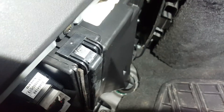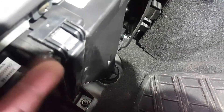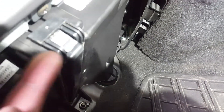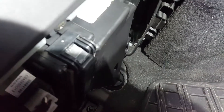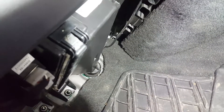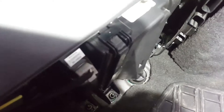You can see it up in there — the slot there, clip at the front. Push it right the way back up in there, and right at the back you'll see that's where the retaining bar is going to clip into. You can see that retaining bar tucked in there nicely. Don't try and get that bit up inside here — it doesn't go there. It actually goes on the outside, and then the latch holds it up. Then it's just a case of putting that kick plate back on with the two screws going across the front.